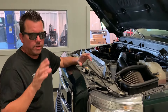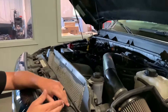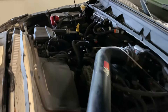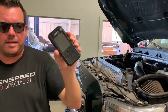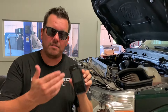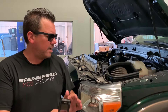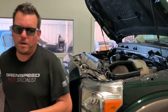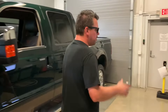I'm going to overlay those graphs so you can see the differences. Look at the engine compartment — the truck came in with a K&N on it. It's got a pretty dirty K&N on it, running 87 octane fuel. This is the SCT-BDX, which is what I use to load our 87 octane calibration on it. There's a little more room for improvement over the factory 87 octane calibration that comes on this truck. And not only in power and torque, but really it's in throttle response. The throttle response is going to be a lot more responsive. It also addresses the transmission — towing, shifting, shift pressures, torque schedules, things like that.